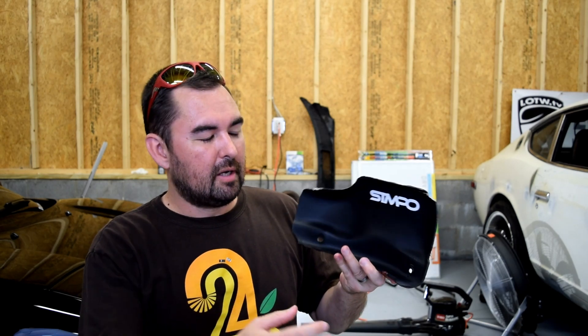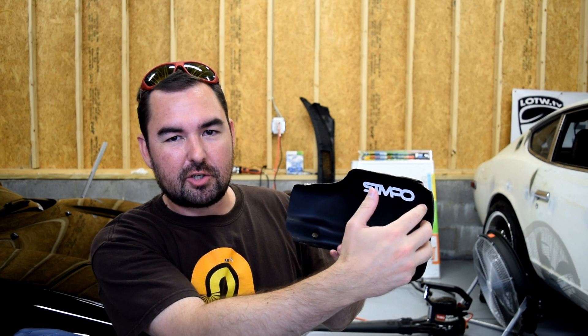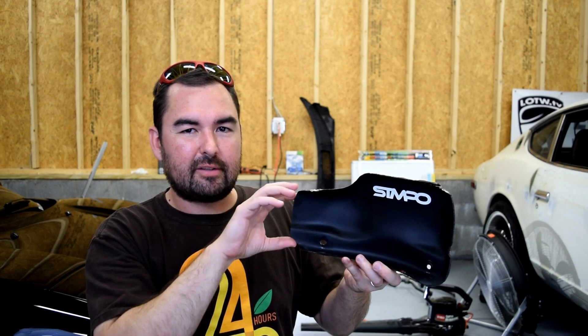Well, that's pretty interesting. I've just watched the test footage, and I'm kind of left with a conclusion that while there may be plausibly some benefit to using a scoop like this at higher speeds, the lower speed benefit and any really appreciable benefit just doesn't seem to pan out. Certainly the mythical scenario — what I think people picture when talking about a brake scoop — of a high speed airstream coming into the leading edge of the scoop, traveling along the scoop, and then being directed out directly onto the critical brake components, really doesn't seem to be happening in this case.